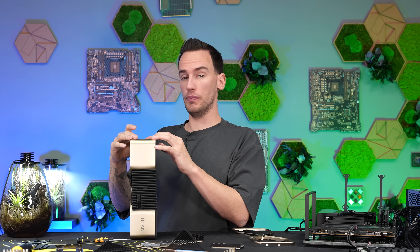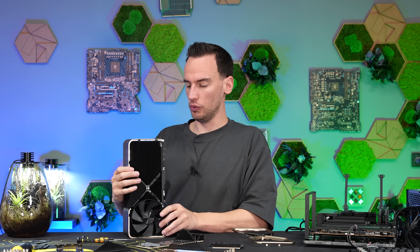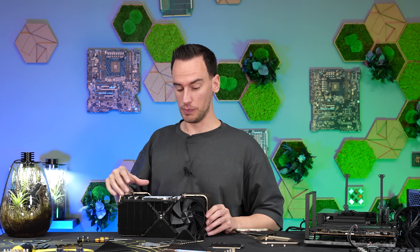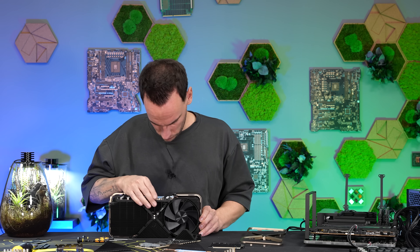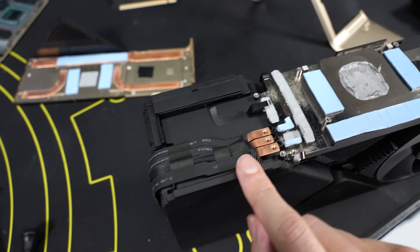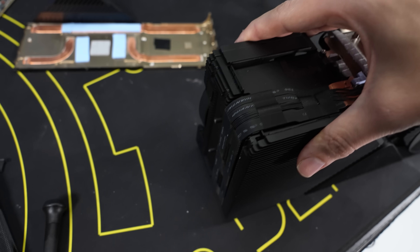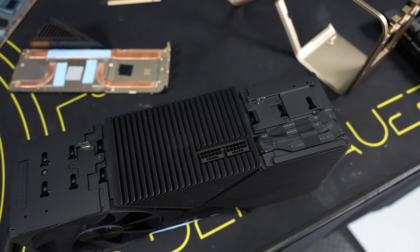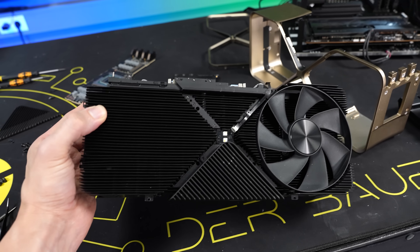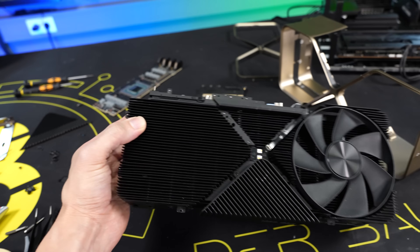The last thing to do is remove the frame from the actual heatsink — everything black — and separate it from the golden frame. It's mind-blowing to disassemble this while thinking about someone having to assemble it, and in mass production this would have been incredibly difficult and expensive. And here we can see it again — solid copper wires, not individual ones, just bent pieces of massive copper — going into the two 12V high power connectors on the front side. It must be so expensive to make this, especially in low quantity for a prototype like this. This single card must be incredibly expensive.